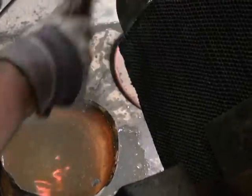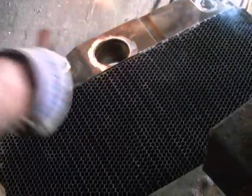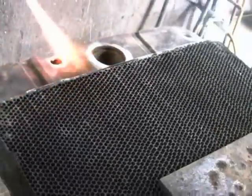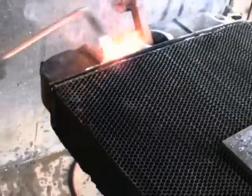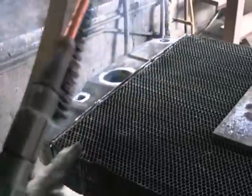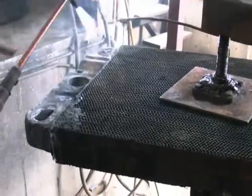I'm using the brush now to clean the last of it, just removing any lumps of solder. When I have the heat right you'll see the tank will separate — there he goes, the heat was correct there. There's water on the other side so I'll turn it back over, reheat that again — the tank will not drop off, it'll come off in my hand.